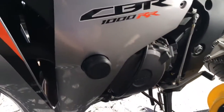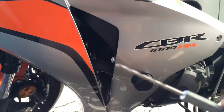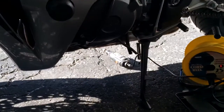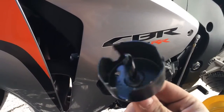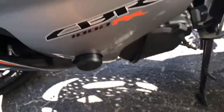So all I did was I drilled a couple of small pilot holes using whatever size drill bit this is. I drilled some pilot holes in, I could see where the bolt is, picked the pilot hole that was the closest, and then went to work with the 2-inch hole saw — which is just slightly smaller than what you would need — so I could shape the hole out a little bit larger with the Dremel.